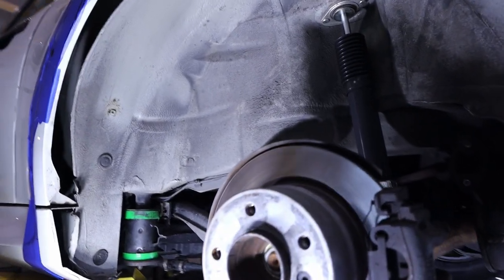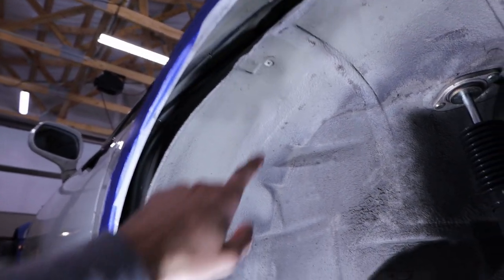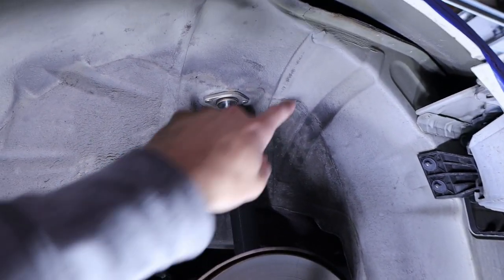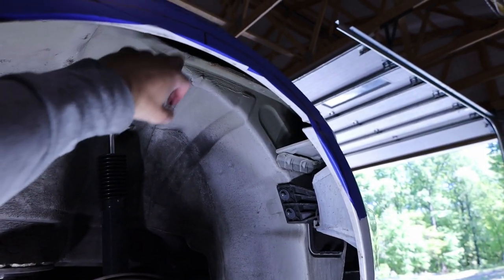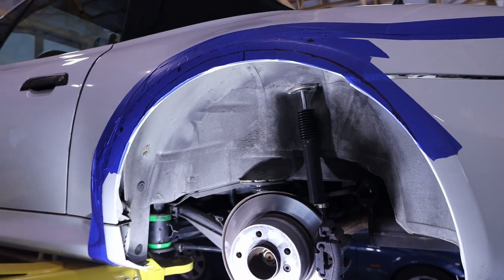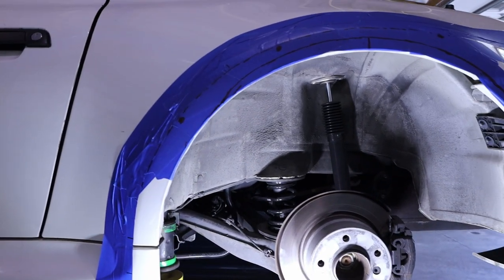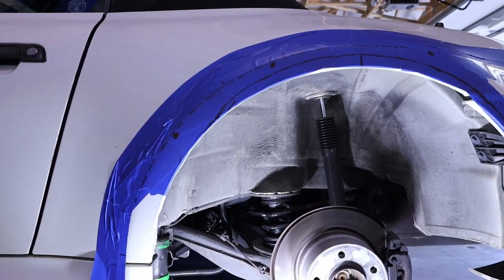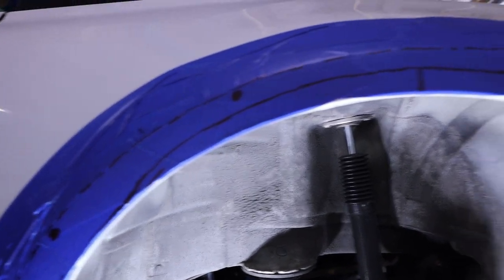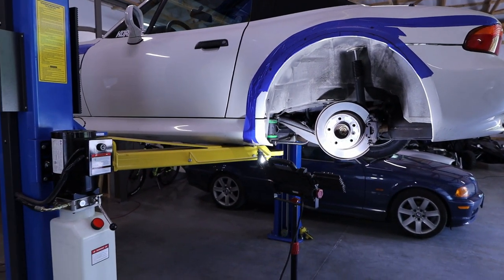That's what I did on the Mustang. But here, as you can see, it's only one piece. Where they're doing all of that structural joining is actually back here — this is the actual structure of the car, where the unibody structure ends. And then this out here is just one piece of sheet metal, so it's all cosmetic. The great part is I can just cut away anything I need and I don't need to worry about re-welding anything, which I was worried about — because those welds might get close to where you're going to be seen and I'd be melting off paint. So I will cut out as much as I need to and just leave some meat left so that I have some points to attach the new fenders underneath.